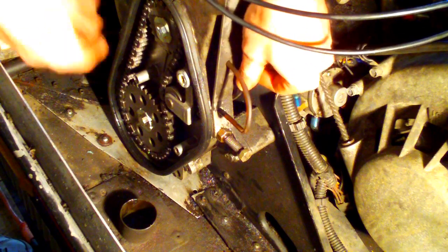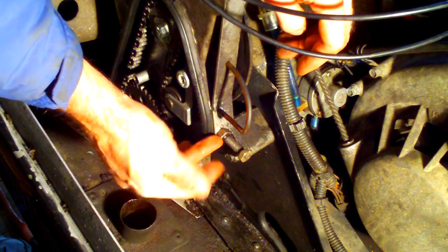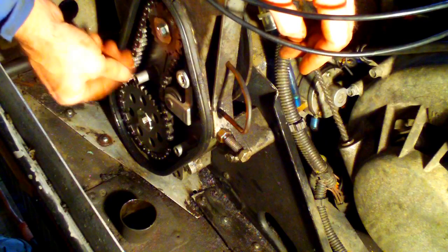The key is to get this bolt to stay still while you tighten up the jam nut. With a reverse motion on the brake disc, I've still got my quarter-inch play back and forth — measured it with the tape measure, pretty much a little over an eighth of an inch each way, giving us our quarter-inch free play. It did take a third try adjusting the jam nut against the bolt before I got it right, because this bolt tends to turn with the jam nut. Twice I tried it and it was too tight; I had to back off the jam nut, back off the bolt a little more, and try again. On the third try, I've got it. We can move on to putting the cover back on.